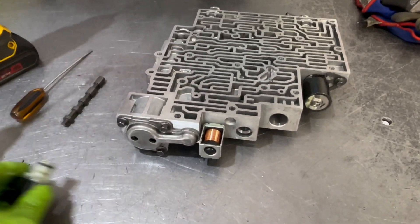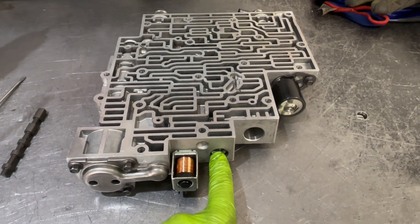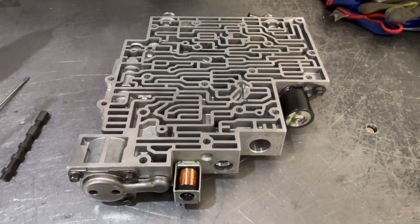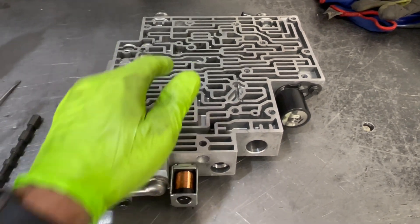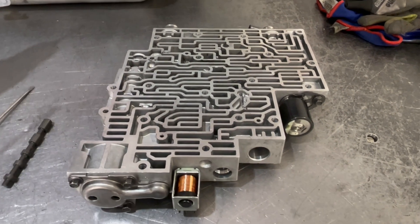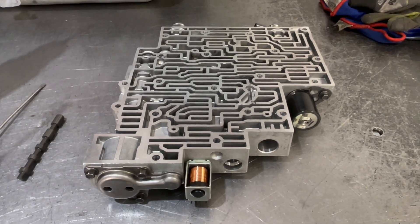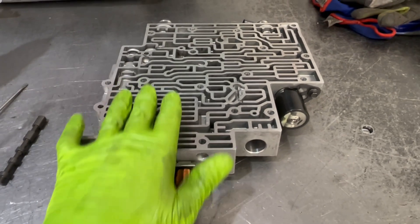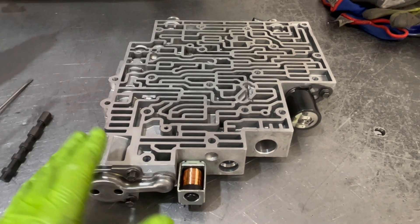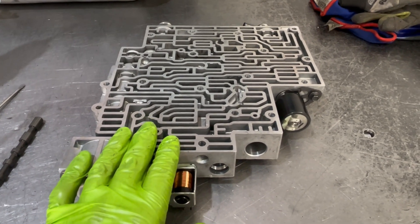Before you put your solenoid back in with your clip, what I like to do is take a screwdriver and a punch. I'll put the punch here, and then I'll use the screwdriver way back where I can start levering or prying forward, and I will move the shift valve to and fro so I can confirm it's not going to drag in the bore. If it is going to drag, I'll remove it, use a bench buddy to polish the bore a little bit, then put it back in and guess and check until it moves without any restriction — but you don't want to overdo it. It's as much art as science. Sonnax actually tells you that you really don't need any bore polishing; just install it straight.